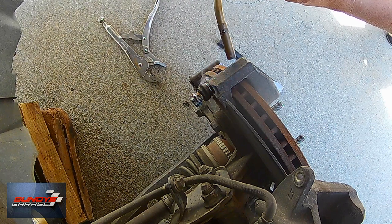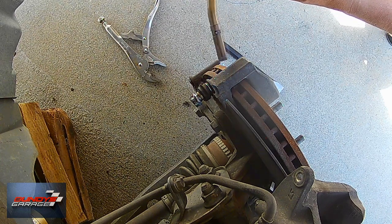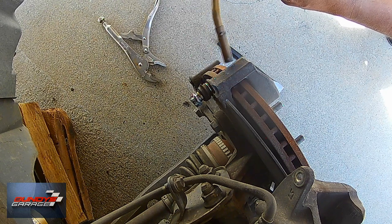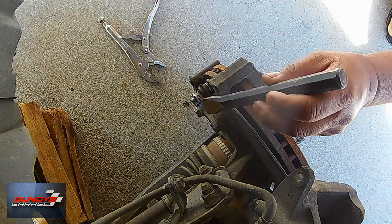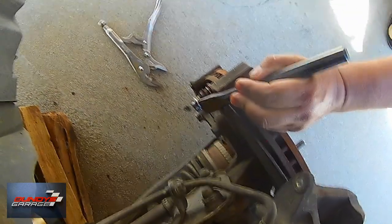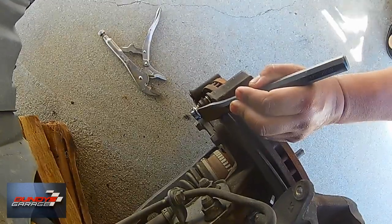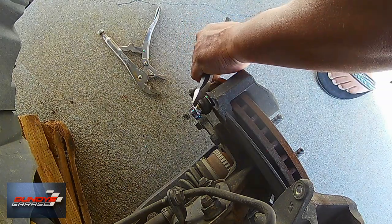One of the best ways I've found to break bolts loose is 50% acetone, 50% ATF. Right here I'm just taking the torch again and getting the brake caliper bracket super, super hot. You can see it's smoking there on the left — it's either melting the rubber or burning off the penetrating oil. It was about a minute to a minute and a half of heat. Then once again I'm trying to get a chisel behind it to get it to move out.